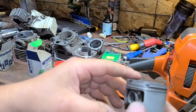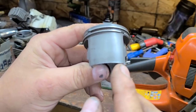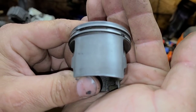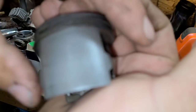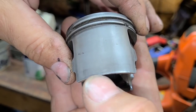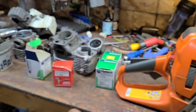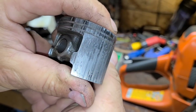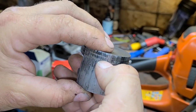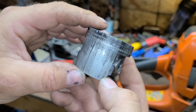This is an MS 440. The intake side's good — see the shiny part though, starting to get wear on the skirt. See the shiny spot and the little chips here. When a piston starts to wear out it will often break the skirt — it'll start to rock and grab. This saw was run horribly lean and just burnt up. Once the ring gets stuck — see how it's sticking out on the intake side and stuck on the exhaust side — that's it, it's over.